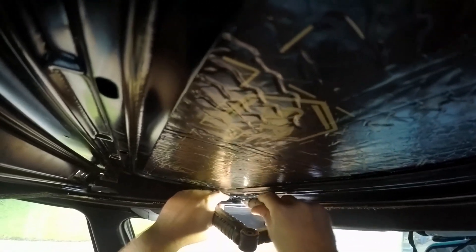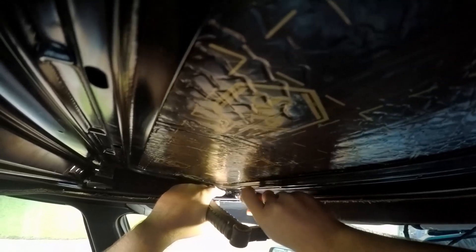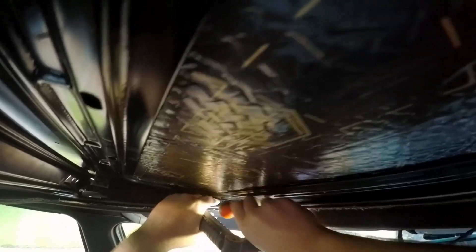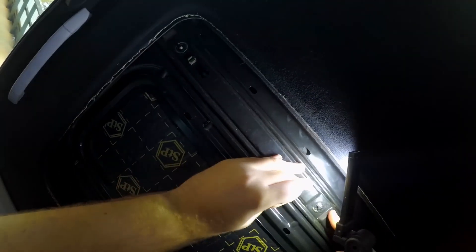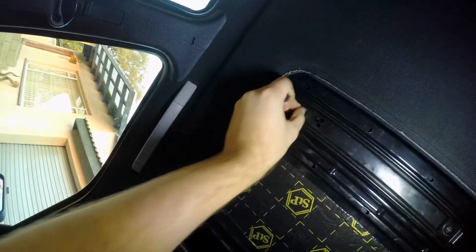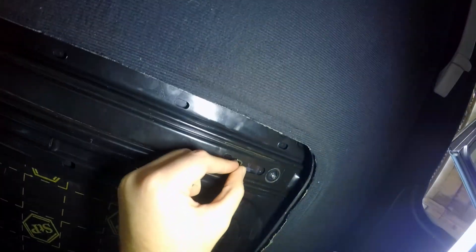You want to move the pin forward until it gets to that little location where it's supposed to sit. It might not pop into place instantly — it might be a little bit too high or a little bit too low. All you want to do is jiggle the sunroof, maybe up and down, give it a little whack, and that should seat everything nicely. Lift the sunroof a little bit with your hands since the back bolts aren't in yet, and put the two front screws in. Line this one up to center — that one's also lined up roughly center. Got that spaced accordingly how it was originally.